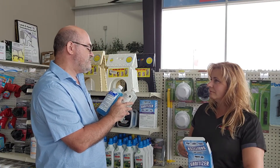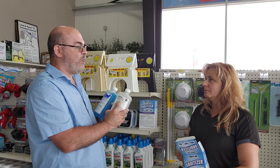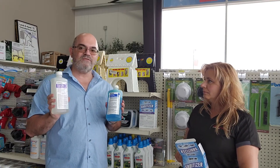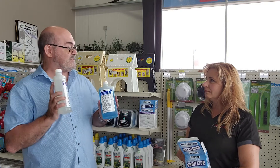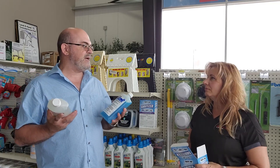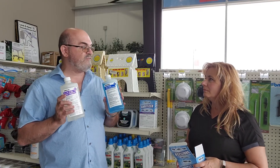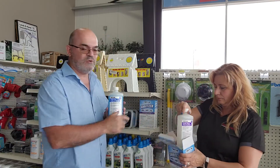The white bottle — the sanitizer — calls for two ounces per eight gallons, so it's half the amount for double the water. You'll also use about half that bottle. Bruno just did his fifth wheel a couple of weeks ago at the start of the season, because there's always residual water in the tank and you don't want bacteria growing in it.